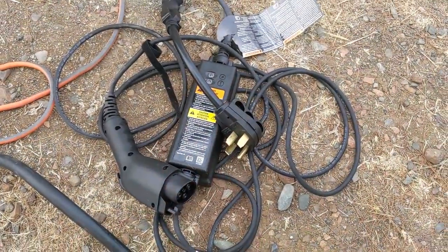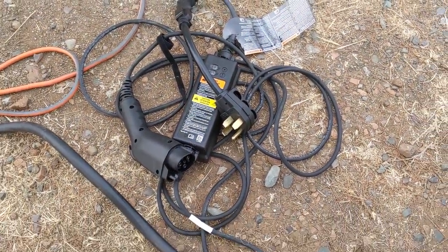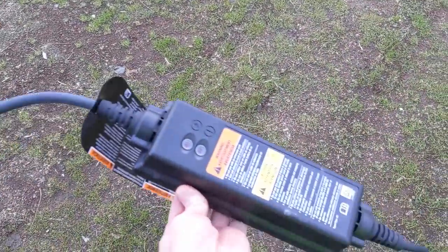This is a really good interim solution for Bolt EV owners who don't want to pay for a more expensive, heavier-duty EVSE — especially if you're only driving 50 to 80 miles a day. Charging at a full 3 kilowatts is the equivalent of about 12 miles per hour added, so over a 10-hour night you're adding over 100 miles of range. It's also something you can take with you on trips — say you're staying at a campsite and you want to leave with a full charge, this will allow you to do that with the stock EVSE.